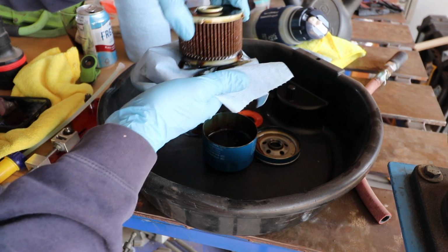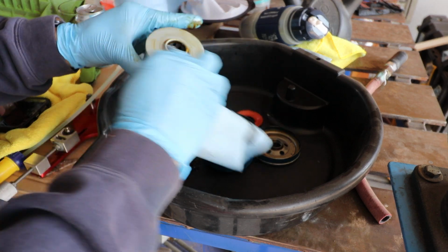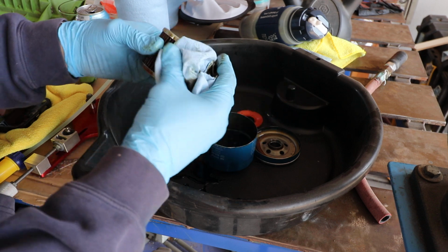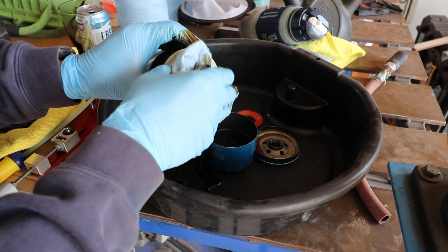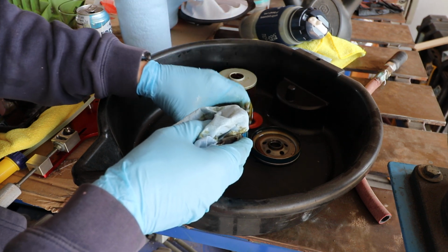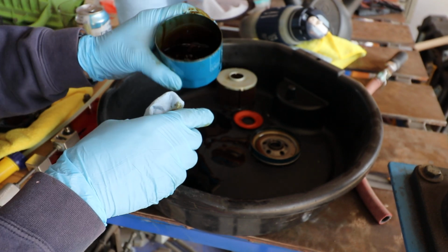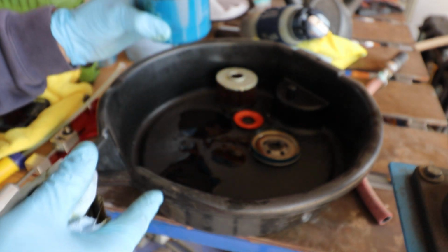And like I might have mentioned, it gives you an opportunity to inspect your filter to see if there's any metal shavings in it or, you know, anything unusual. The best part is that you don't have to cause a mess by using an X-Acto knife or any kind of knife to try and cut the housing. It just comes in handy if you do a lot of your own oil changes and you just want to inspect your filters. It lets you know if you need a better quality filter or not. I've seen guys open these really cheap filters that show how bad the filters are inside just by using one of these wrenches. See that? I don't see anything at the bottom. Let me go ahead and dump this just a second.